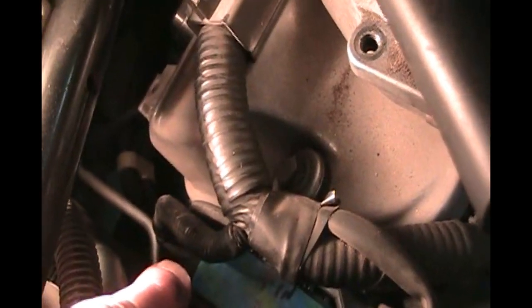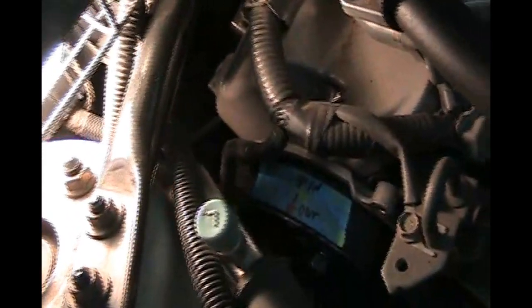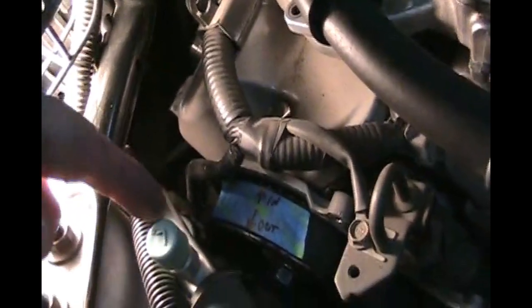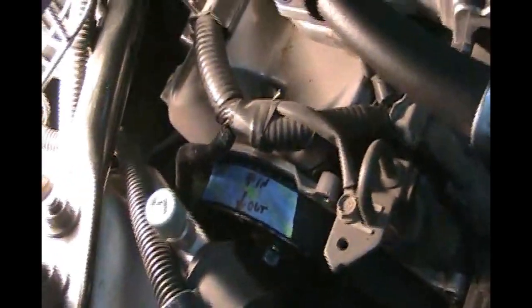This rear cover has the same markings — I have a white mark lined up with the white mark on the pulley for top dead center. That's the back pulley, just like the front pulley. I've marked the belt to make it easier — that pulley does not need to come off. What we're going to do is get on the back side of it, way down in the back there, and we're going to put the long battery hold-down threaded rod down the back side of that belt, following the path of the belt on the outside.